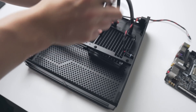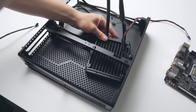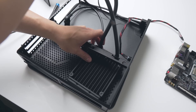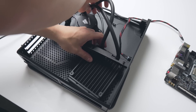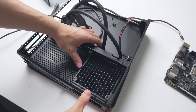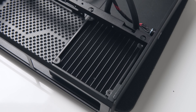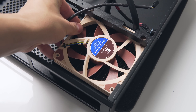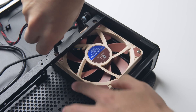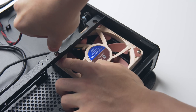Next, let's talk about the radiator and fan. In terms of thickness, the Sentry 2.0 only allows 50 millimeters total when adding up the radiator and fan combined. I'm using the Corsair H55, which has a 27mm radiator, paired with a 15mm slim fan from Noctua — the NF-A12x15. That gives us 42 millimeters of total thickness, so about 8 millimeters of clearance from the frame.